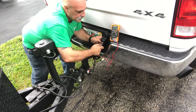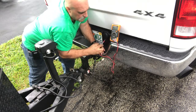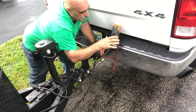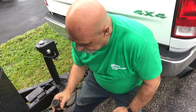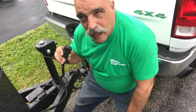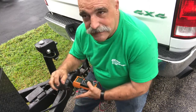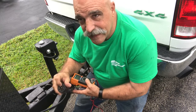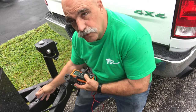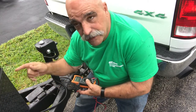We got 14. That means the alternator is pumping it out. We're getting plenty of power to be able to charge the other battery. Now we have the seven pin — the notch goes into the top. So we know this is the positive and this is the negative. We trace those two wires, and then we're going to run new wire into the trailer and put it on the battery.